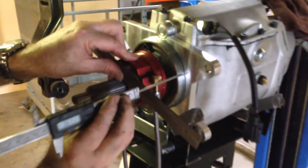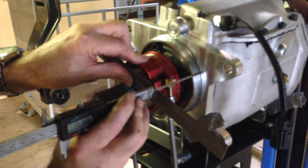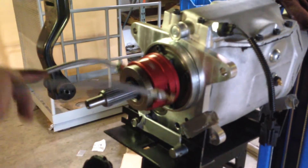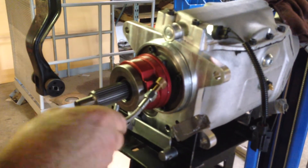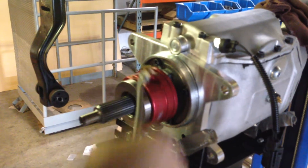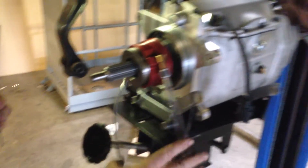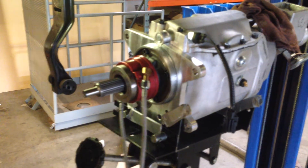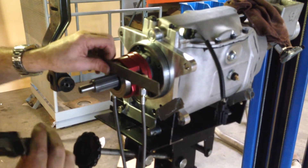You can see I'm not to the straight edge — I've got way too much clearance. So I'm going to take the bearing and adjust it. It's on a little jack screw, and with the hoses it's a little difficult on the transmission jack sometimes. I'm going to adjust this out — it's just like unthreading a nut on a bolt and it comes out.